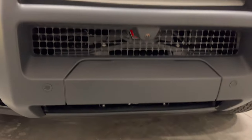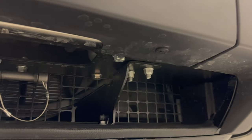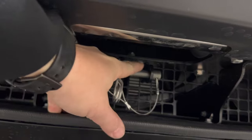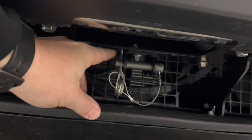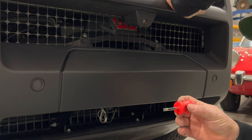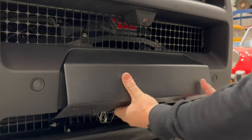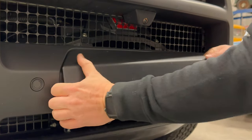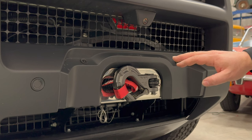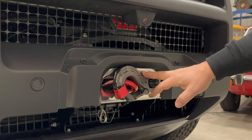Let me take that panel off right now. It's just two screws that you quarter-turn on the bottom — there's one right there, another one over here. And if you don't want to have your hook on it, it's really neat that they included this: you can wrap your cable around, hook it onto this pin, tighten it up, and it's all secured underneath this cover. I'm using a little stubby screwdriver, but you could probably use a quarter to get these off. Just pull it from the bottom and there are two pins up here that hold it secure.